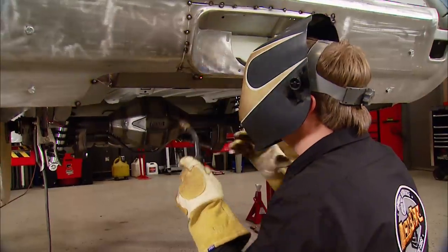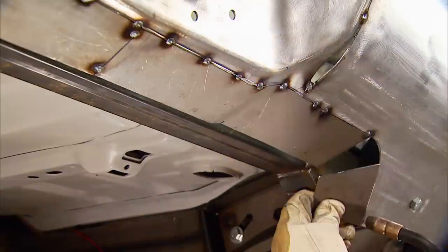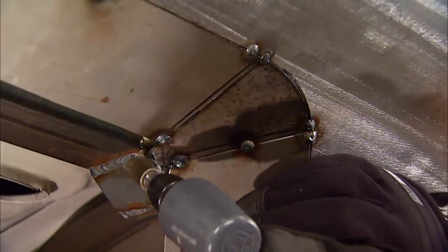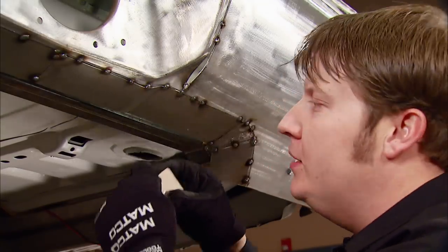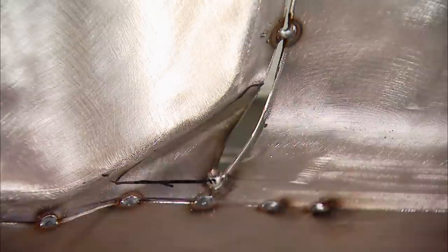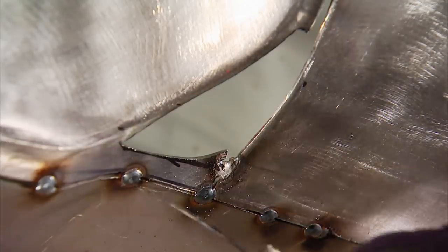Make sure you're using the right metal for the job. This bumper is made of thicker metal than the body panel, and I'm using 10-gauge steel, which matches up to the bumper pretty well. A cardboard template helps me not waste steel, and once I've got it cut to shape, I'll reproduce it in metal and tack it in. A die grinder with a rotary file will finish up our inside corner. This little recess around the license plate hole needed a patch, so I made a template using cardboard and transferred it to a piece of steel. I'll make sure the piece is carved the way I want it, then draw a line around it to cut the metal hanging behind — because not doing that creates a pocket for moisture, dirt, and debris to collect, and then you've got yourself a rust farm. Once I use the air saw to get rid of all the unwanted metal, I can tack in my patch and call it good.